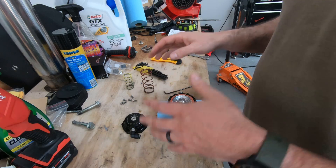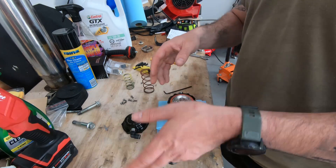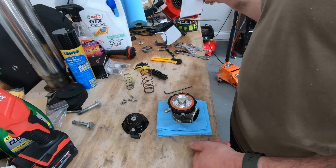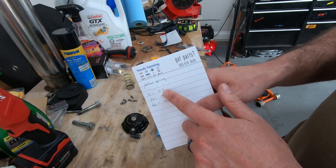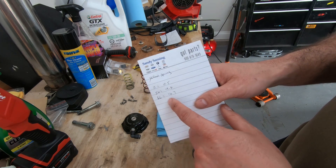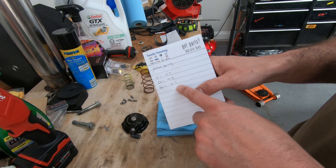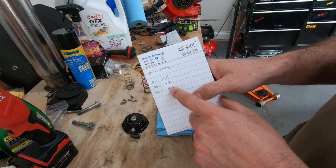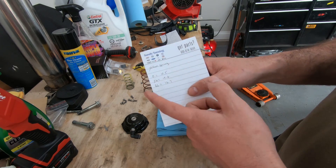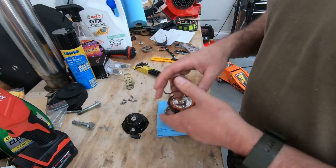With the 10-pound spring, I didn't give myself enough time to test it on the street — I just went right to the track and was chasing it the whole time. This spring made 10.5 PSI at wastegate. 56% duty cycle gave me 14.6, and 66% duty cycle gave me 16.7. There were times where I had 66% duty cycle on the track and it was good — I'd hit like 17 pounds, and a couple times it would hook real well in third and hit 18 pounds. But I'm just going to go back to the 8-pound spring and go from there.